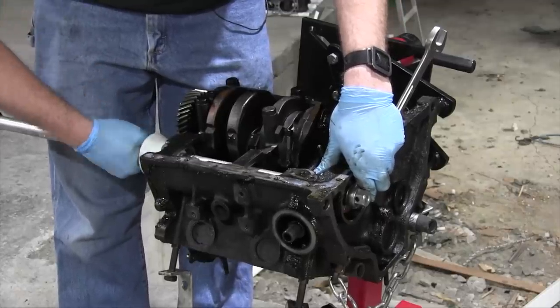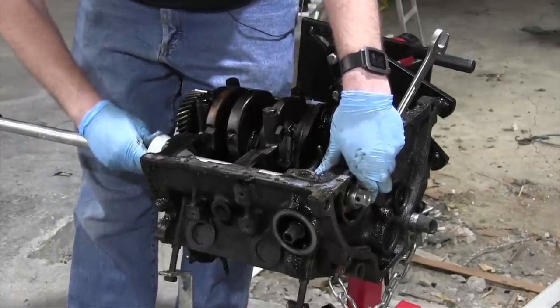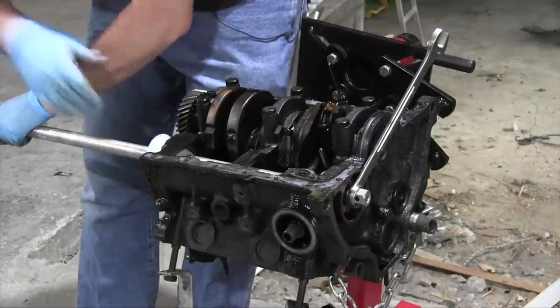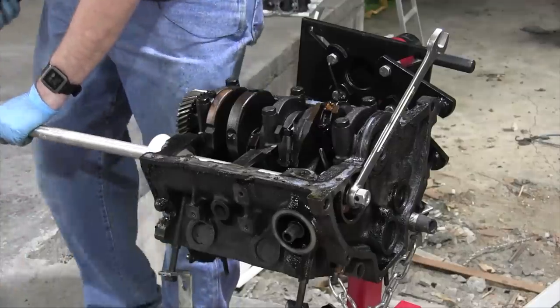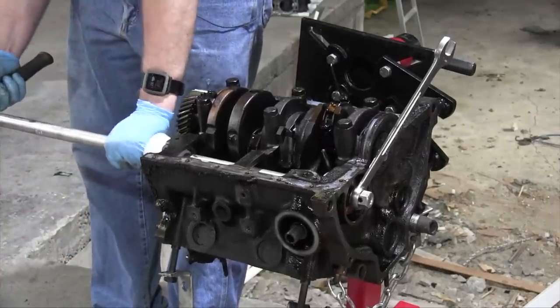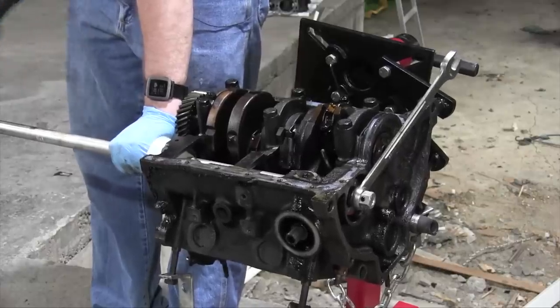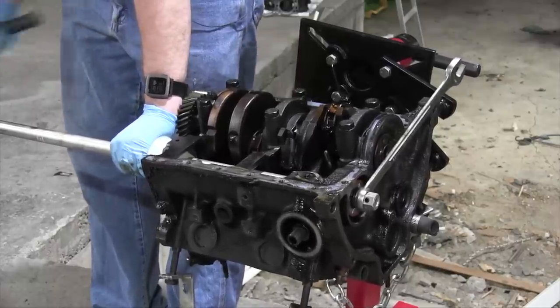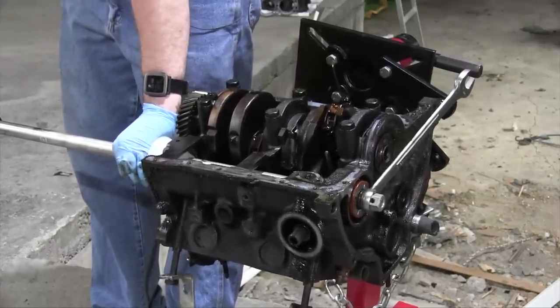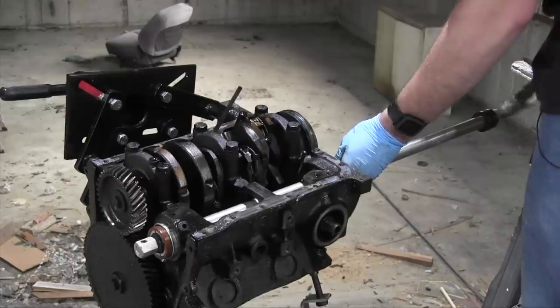What this is doing is expanding the bearing puller around the bearing. So there's a flange behind the bearing and I just hit it with the wacky stick. Let's hold the centering cone there. This is working incredibly well, actually. And the bearing is out.